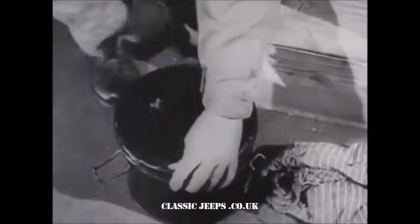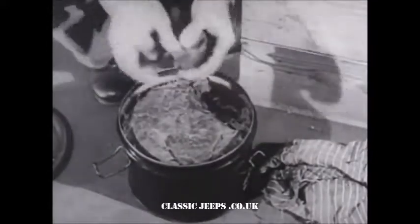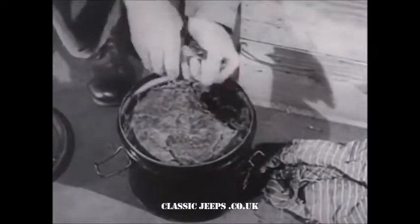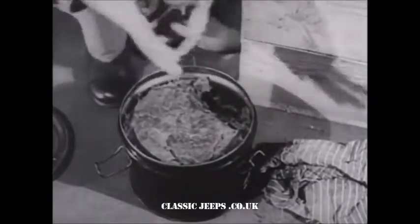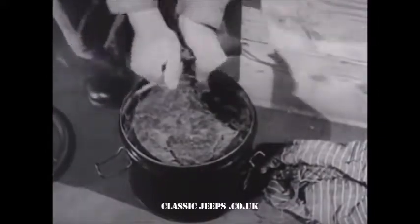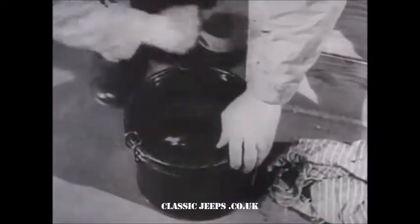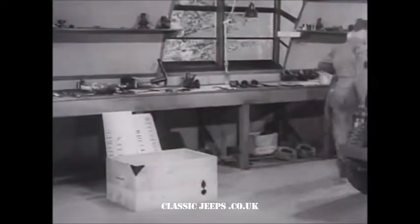A kit contains the asbestos waterproofing compound and all other necessary materials. The compound itself is a thick, pliable substance that can be worked much in the manner of modeling clay or putty. During the whole waterproofing process, the driver's hands, the compound, and the parts to be sealed must be free of dirt, moisture, and grease. Other items contained in the kit are lengths of soft iron wire, rags, friction tape, copper wire, and flexible air intake tubing.